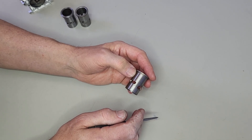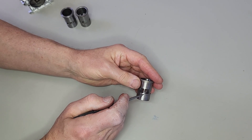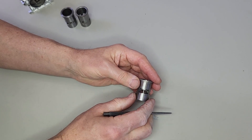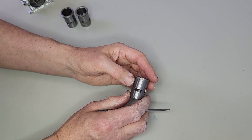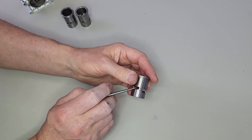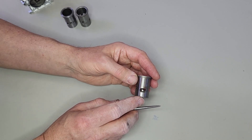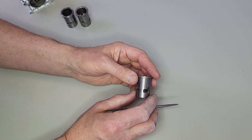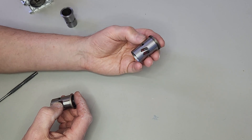Here is a typical liner from a two-stroke model engine — it's a Schnuerle ported design. We can take note of the exhaust ports here, and the bar down the middle that's to stop the piston ring from breaking through. We've got the inlet port there, another inlet port there, and the booster port, which is timed to open slightly later than the inlet ports.